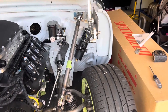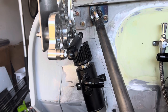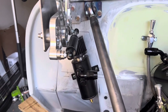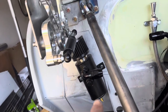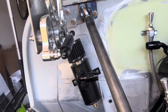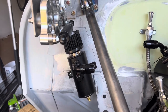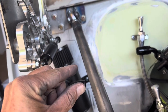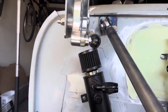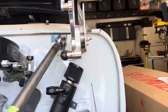Just another installment of fixing my F-ups. I installed these two breather cans on either side and I even drew out where my inner fender panels sort of live — that little mark on the firewall. When I measured and mounted them, I mounted them too tall — the breather was actually above that line. I thought I'd have to re-drill the holes, but then I thought to pop up the little breather cap. The rubber neck was about a half inch long, and I cut a quarter inch off — just enough to put that clamp on it. And it was just enough to get it to clear underneath the fender panel. Nice little win right there.